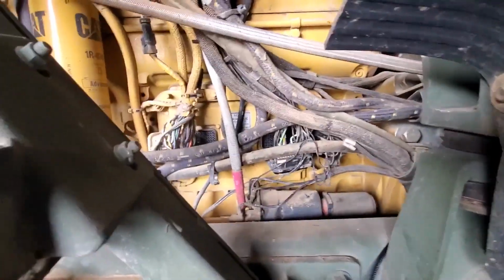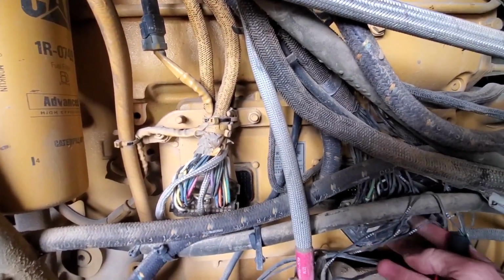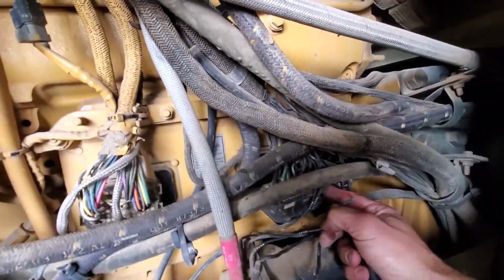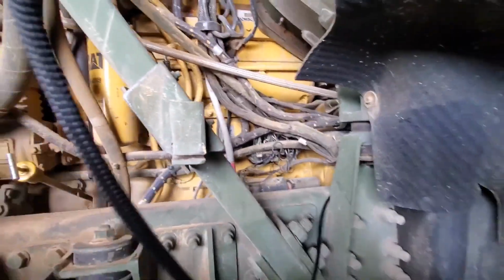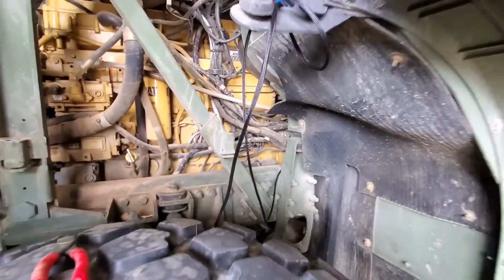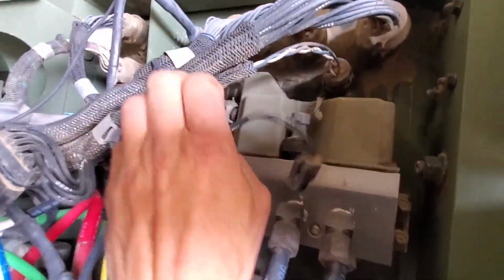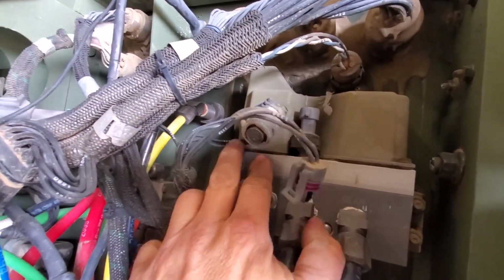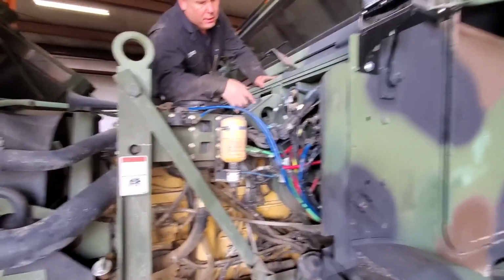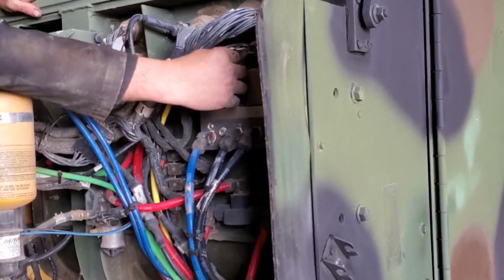The engine control module has 2 plugs. You may have to remove hydraulic lines and air lines out of the way to access the further back connector. These look like they've got dielectric grease on them to help keep the corrosion down and hopefully promote connectivity. Those are probably the 2 most obvious on the whole truck, but they are a pain to get to because of the hose. I see this disconnected from the CTIS control, right, Tony? Yes, the valve body. There is a Cannon plug on the side of the controller to remove, and 1 weather pack connector for a sensor.